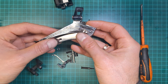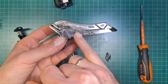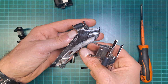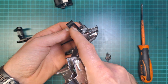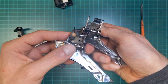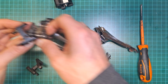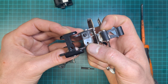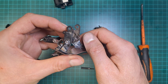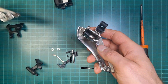Finally, the cage from Ultegra — Dura-Ace has exactly the same measurements, no difference whatsoever. The only difference is Dura-Ace has slightly more machining or less material. If you look at GRX or 105, the cage size and arm are exactly the same; the only difference is the carrier. As you can see there is a little step on the GRX carrier, whereas on the Ultegra carrier it's flat. So if you were to put a GRX cage on an Ultegra carrier you'd need to add a washer — it may work but it might be painful. Another way is to drill out the through-bolt pin and replace the carrier.